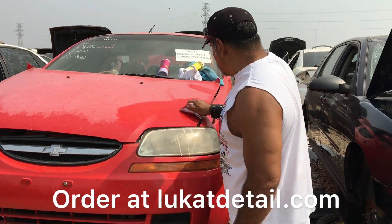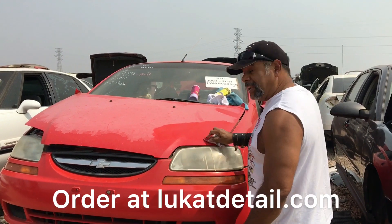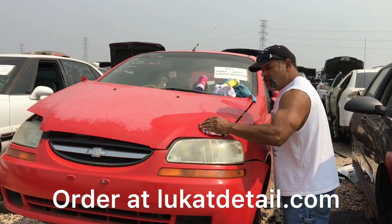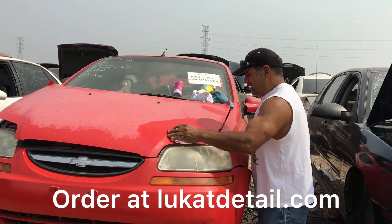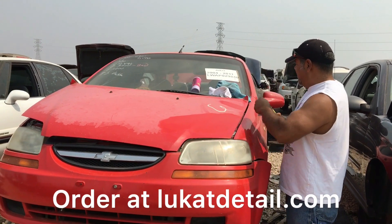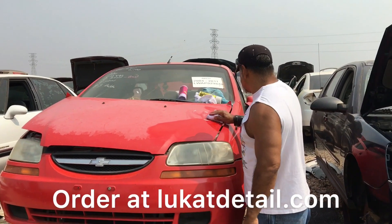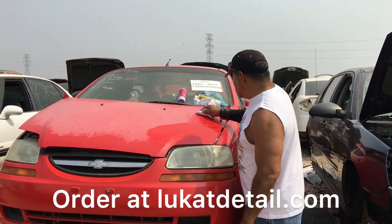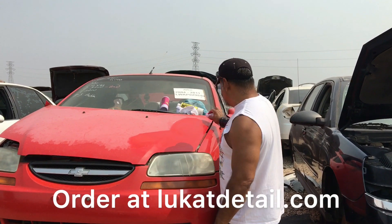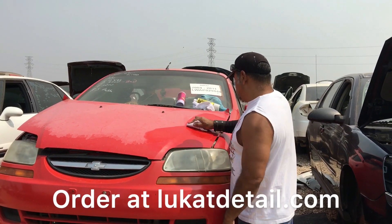The paint that's chalky and falling apart still has a lot of good color on it. So all you have to do is clean it, not wax it. You're going to go through a few towels if you do this by hand. If you have a machine and know how to use a polisher, it's a piece of cake — use a cloth or woolly pad on it. Don't use foam pads, because this is not wax, it's cleaner. There are no lubricants in it. It's pure cleaner.